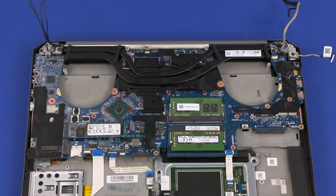After system board replacement, be sure to complete post-installation tasks as required, including verifying functionality of the notebook, updating the BIOS, updating DMI, and other settings.